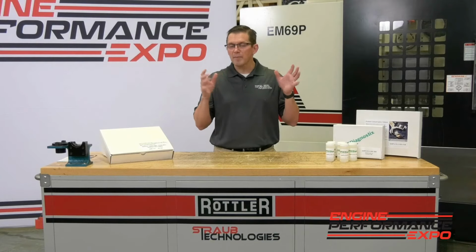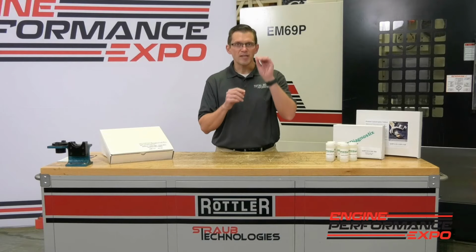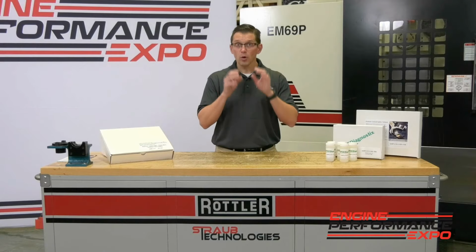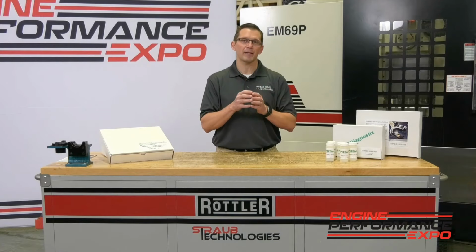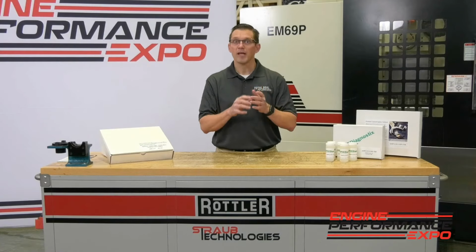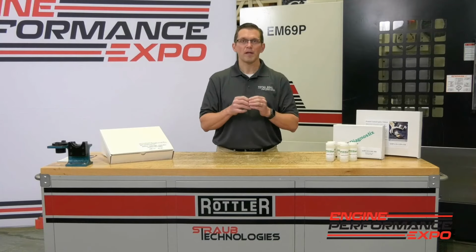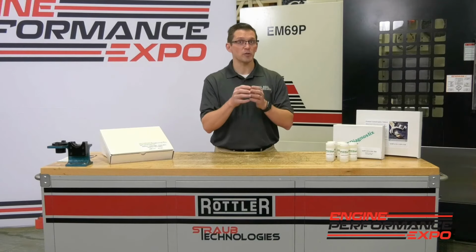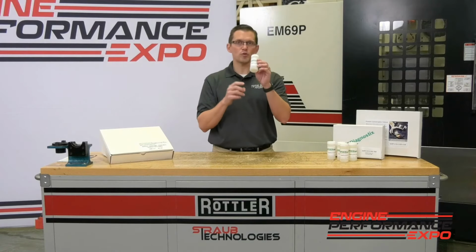You know, as an oil guy in my previous life before coming to Total Seal, I can tell you that contamination is the number one issue with your motor oil. Your oil is going to do the job it's designed to do unless it gets contaminated. And contamination can come from a couple of things. It can come from fuel, it can come from coolant leaks, but also the wear metal. Your engine is telling you if it's happy or unhappy. You just have to listen to it. The best way to listen to it is via used oil analysis.